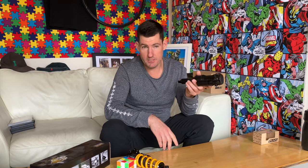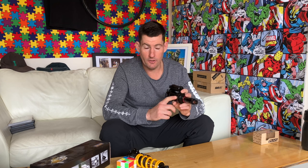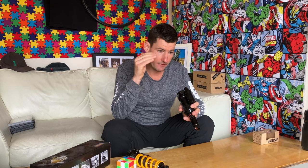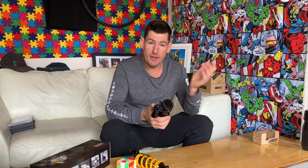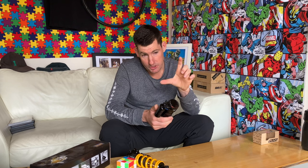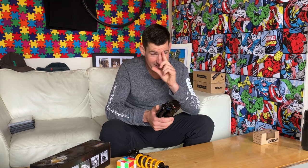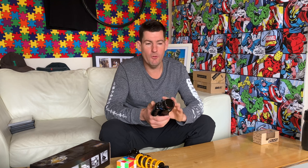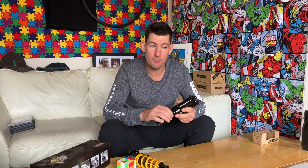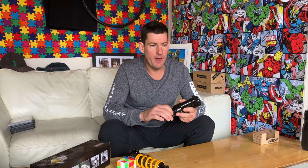Four tokens was as close as I got to ironing out that mid-stroke - that really strong, under-your-feet feeling on hits. Two bands is worse, no bands is way worse, three bands is a little better, four bands is better again, but still not quite there. Swapping the cans out, the standard can has a different characteristic entirely. At that ratio where you've got such a large positive and such a small negative, it doesn't make for a great feeling.